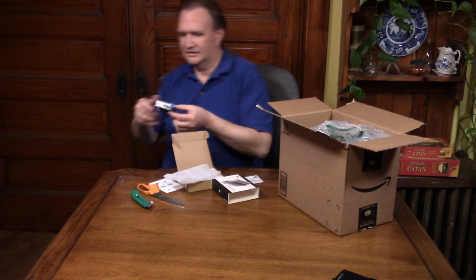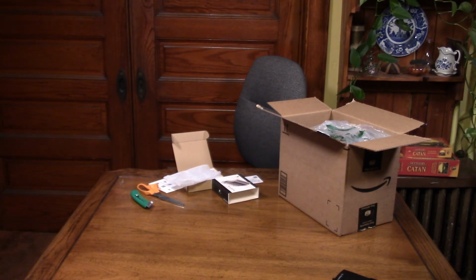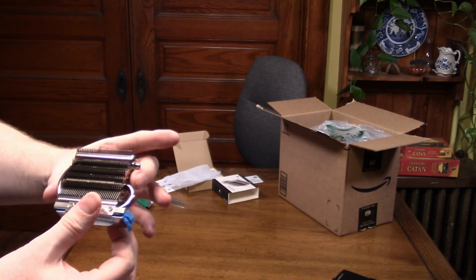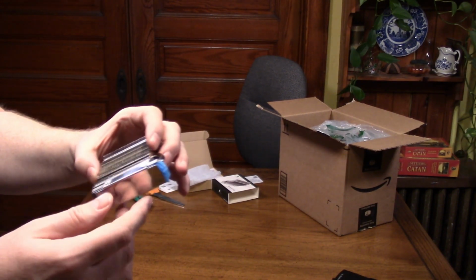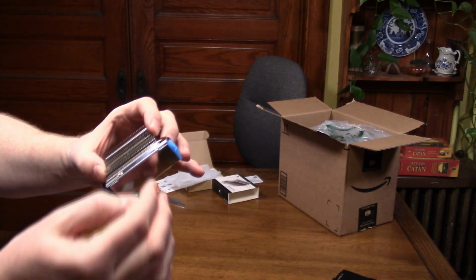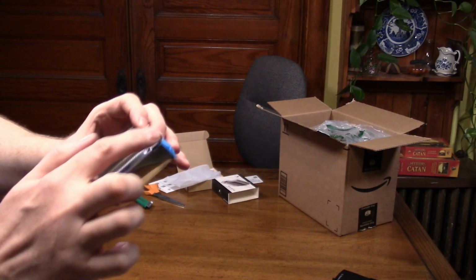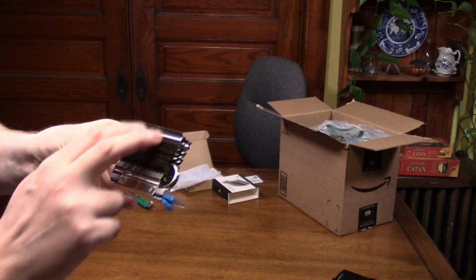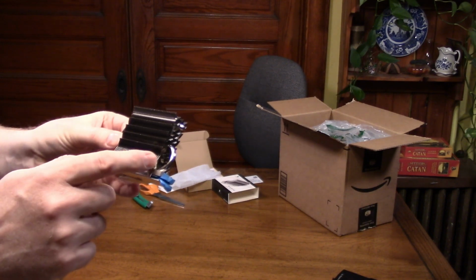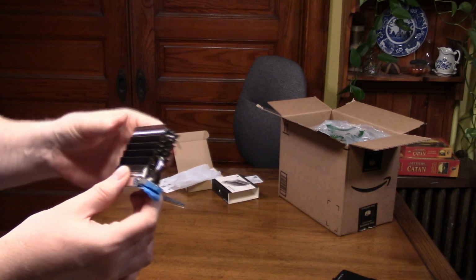Alright, look at that. It's the dual heat pipe SSD cooler, which is just ridiculous. The SSD would sandwich in there, so you'd put it in and put the screws in, and that would hold it up against this plate, the chips up against that plate. Then the fins are connected right to it, but the heat pipes would bring the heat up here and up there to help bring it to the top faster.